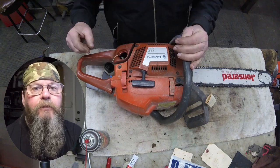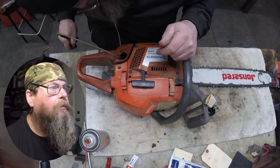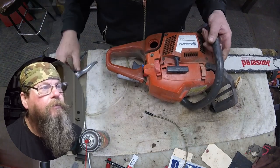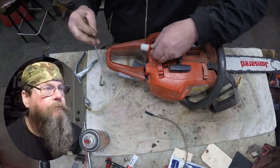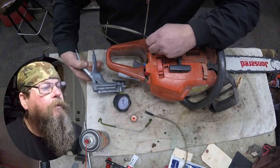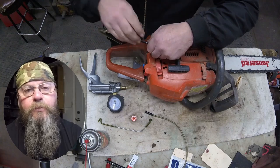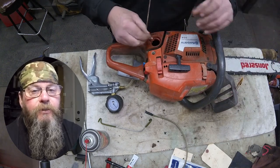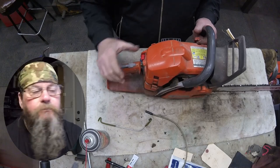Welcome to the Greasy Shop Rag. Today we're going to take a look at a Husqvarna 359 — customer complaint is that it runs crappy if at all. First thing we want to do is see what the customer is running for fuel. Quick look inside the tank — the fuel looks all right. We fish that filter out and pressurize the fuel line. We put 10 pounds of pressure on it, it stayed at 10 pounds, so the fuel line is good, the carburetor is sealed tight, and the filter goes back on.